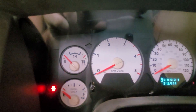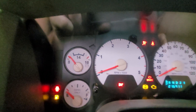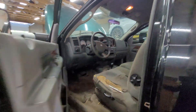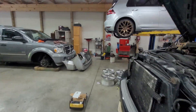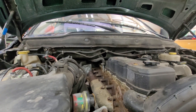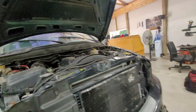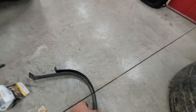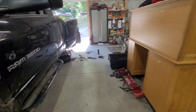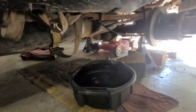For giggles I'll crank it — it won't start but watch the tach. The tach actually moves when it's cranking — that's what it's supposed to do. When it would fire up it would stay at 200. So send me your tach clusters, I'll fix them — $175 bucks, you ship them. Just make sure you send me an email first so I know where to send it back. This wasn't on the agenda but I saw the fuel tank issue in the back. I need to verify the fuel pump works first, and the tank is held up with a ratchet strap so I need to assess that situation.